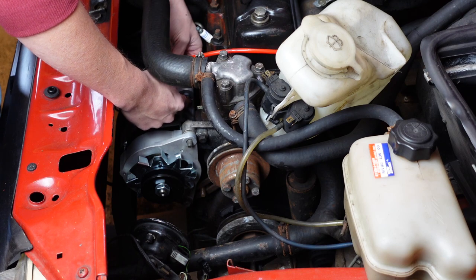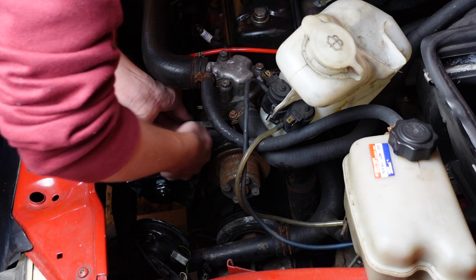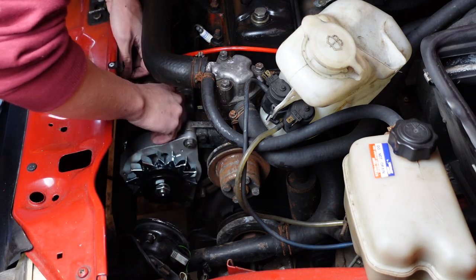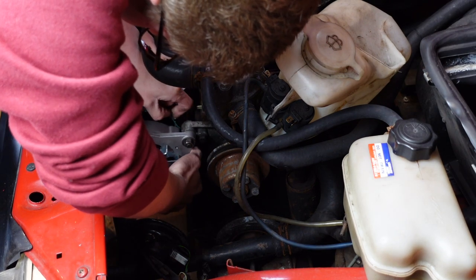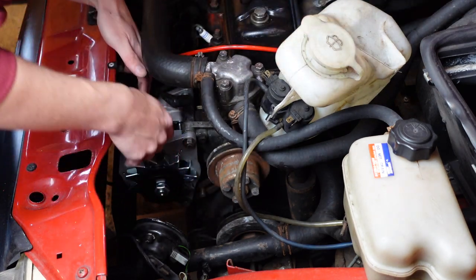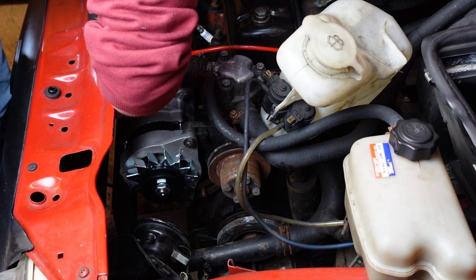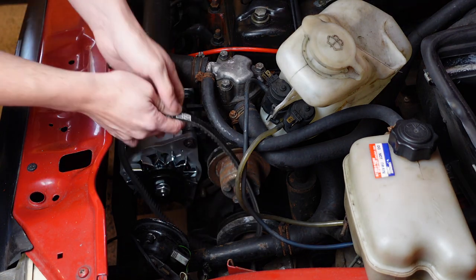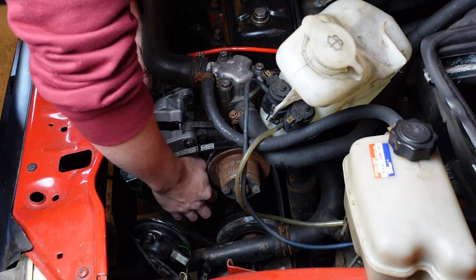With the new plug fitted securely to the wiring loom, the new alternator can finally be threaded around the bodywork and into place. All this is doing so far is highlighting how filthy the engine bay is generally — I promise a full engine bay clean will be coming soon, probably before a service, because priorities. The angle at which I bolted the sliding adjustment bracket to the alternator is critical in ensuring it pivots cleanly, so I left it loose until I had the alternator secured to the engine. The old belt was seriously worn and stretched — in fact it was adjusted all the way and still wasn't quite tight enough.